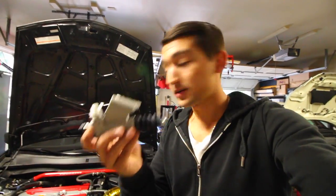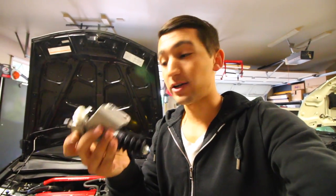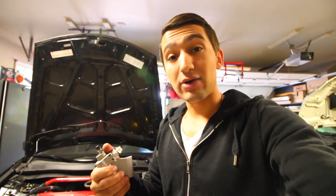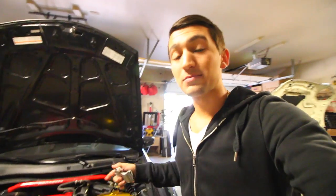The difference is that the slave cylinder and the master cylinder I have for this vehicle is different. This thing has a lag system in it. The slave cylinder built into these cars has a little oil restrictor, so what it does is it delays how much fluid can go in at any one time, so it doesn't allow you to shift at very high RPMs quickly.